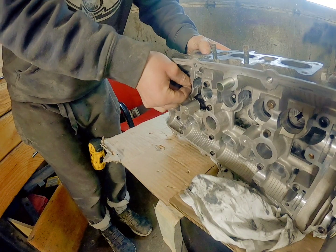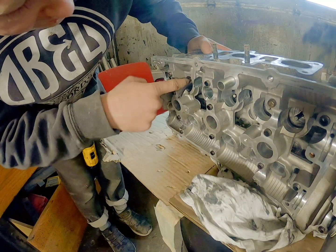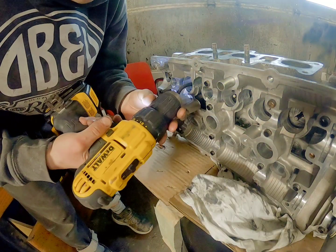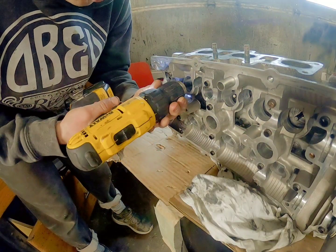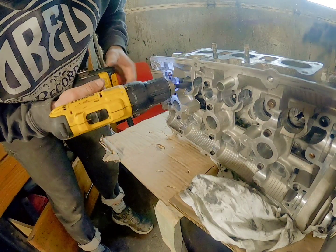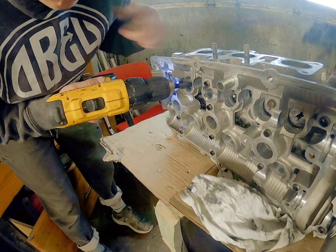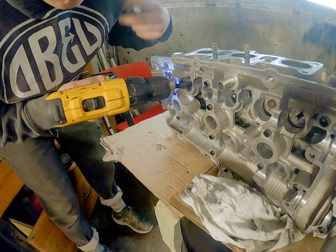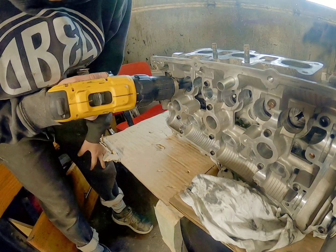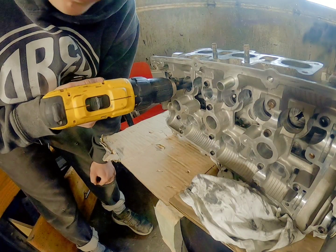Get it on really nice. You can use needle nose pliers, but I just try and use my fingers so I don't damage anything, because if you damage the tappets and the HLAs, that's not good. So I'm just going to put the drill onto the actual vacuum line. This is the motion I'm doing when it's on — and you listen for the grit. It'll sound really aggressive, then it'll sort of go away. And once it goes away, lift off. Once you know that sound, you just keep doing that. You're here for about a minute — do it about 20 times, then take a look.